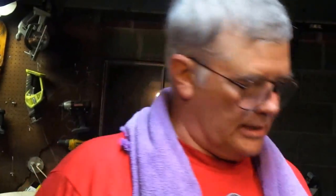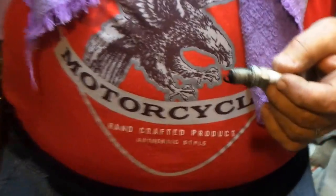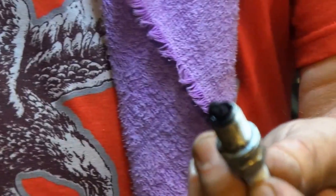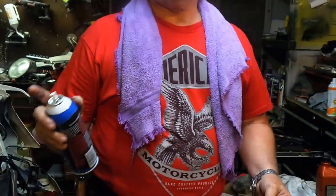The head is completely torqued. Next thing is to put the spark plugs in because they need to be torqued, and it's easier to do it now than once you get further down the road — it also keeps stuff from falling into that cylinder head. These were brand new plugs when we put them in, but since they never really fired, you can see they're black. Clean the threads off with the ether first.